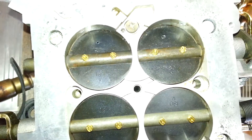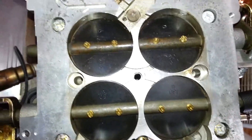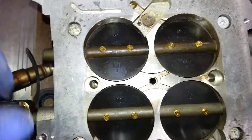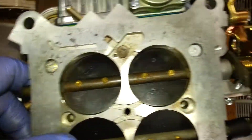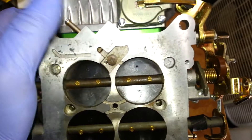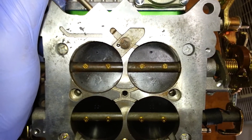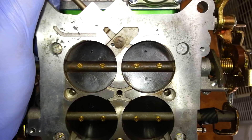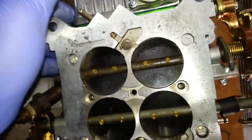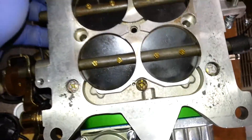About a minute later — got both holes in here on the front bowl drilled through. I'm going to do some more cleanup, spray it down, blow it dry, and put it back in the car to see if this helps the idle. If not, it's a sixteenth — you can go up progressively to an eighth inch total, and you can try the back as well.